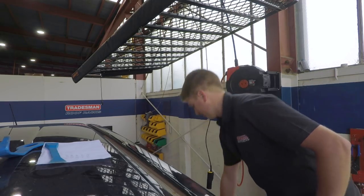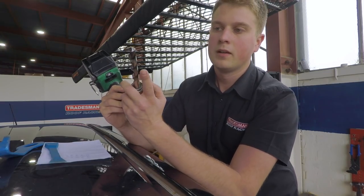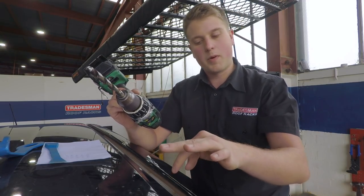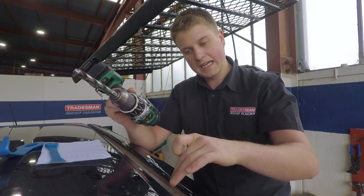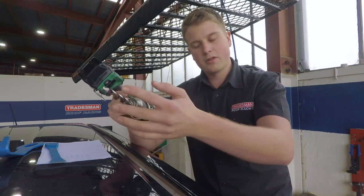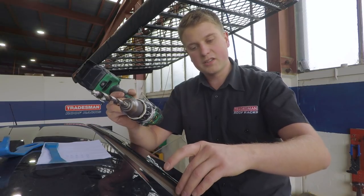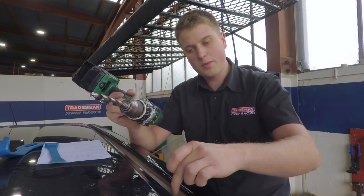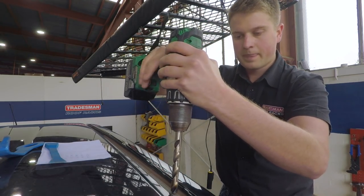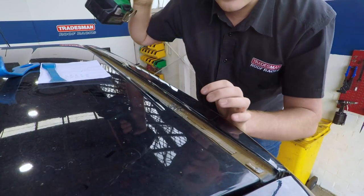The reason I did that is because I'm using a 13mm drill bit. The reason I use a 13mm drill bit is that under this roof skin is an 8mm thread. If I were to follow and drill the hole there, there's a chance I could nick the thread — which means I'm in a lot of trouble, having to re-tap the thread and so on. I use a big drill bit because I've divoted and put a divot in the roof, so the drill bit doesn't wander on the skin. It stays in the spot and just opens up nicely above my thread without damaging it.